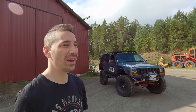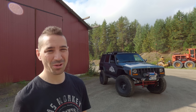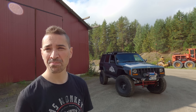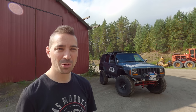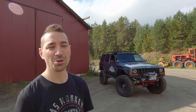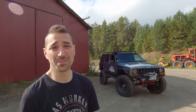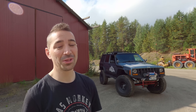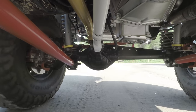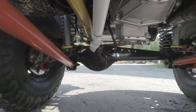Well, that's it for this episode. Hopefully mission accomplished - that driveshaft seemed to be behaving itself and it didn't really feel like it was vibrating, even at real high speed. Rotating the CVs on the axle, good pinion angle, good caster and other geometry are going to help that. But the reality is that shaft still isn't balanced, and neither is the rear one. There probably will be some long-term issues with that - it's going to put excess strain on bearings and other things like that.